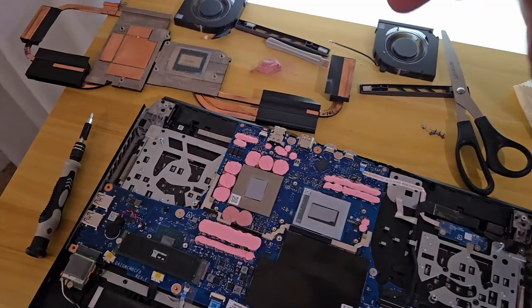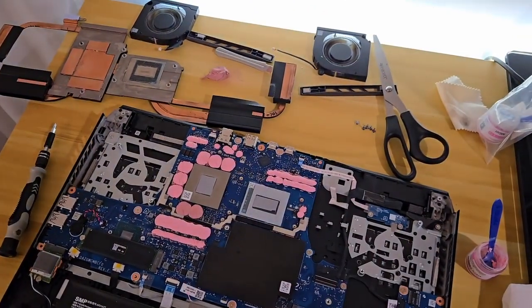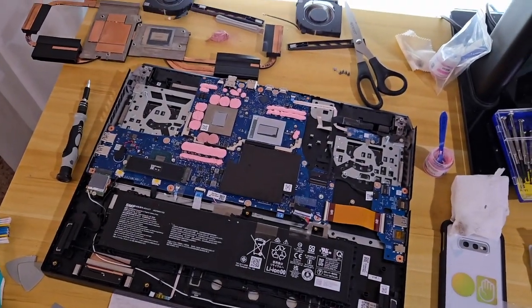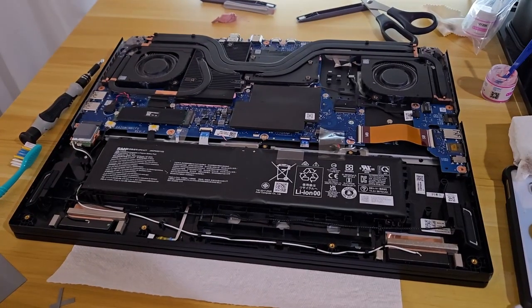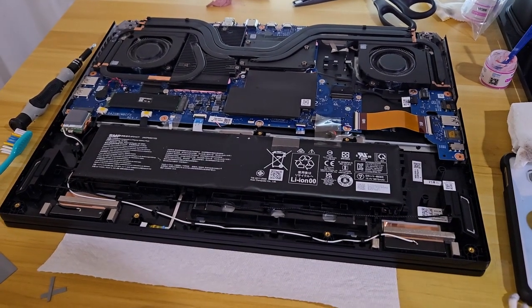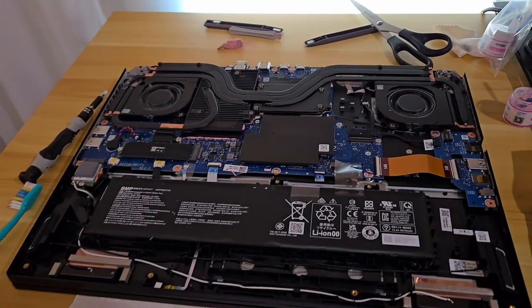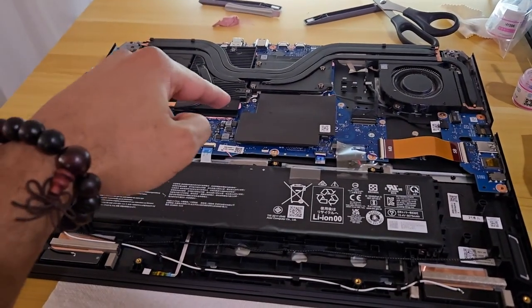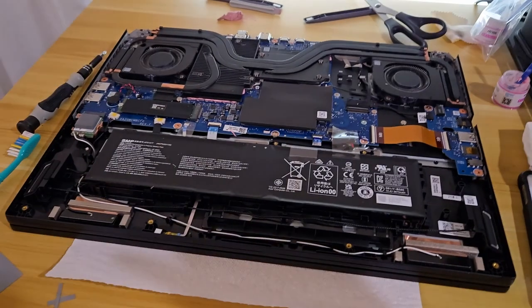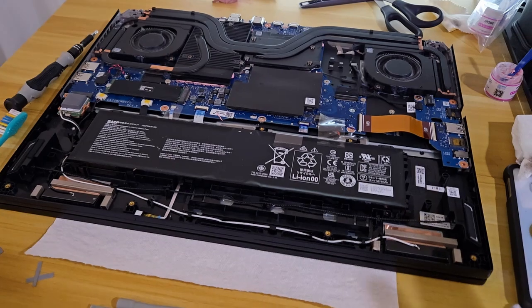What I'm going to try to do is put the heatsink back on without messing anything up, put the fans back in, plug them back in, plug the battery back in, and see if this thing actually turns on. Heatsink is screwed back in, fans are plugged in, battery is plugged in — that's pretty much everything. You can see the old putty over there and some of the new putty squeezing out. At this point you want to open up the laptop right now and turn it on to see if it works. I just did it and it does.